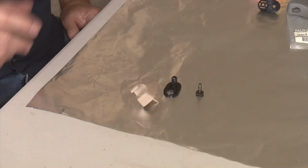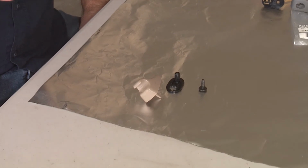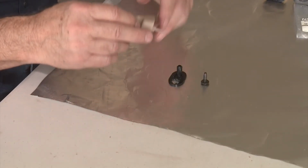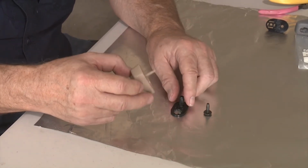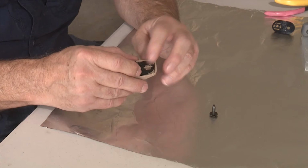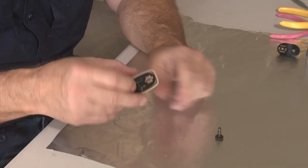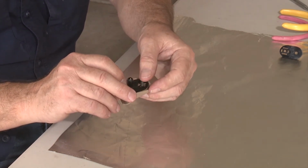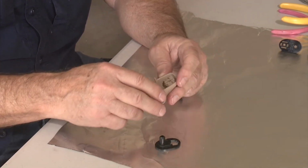So as we mentioned in the intro, a couple of things didn't quite go right as we were working on getting the moonroof motor put in place. One of the items was the passenger side sun visor. So this is the interior hook for the sun visor, not the pivot point. And when we pulled it out, the holder mechanism, which goes right there, broke. So this thing goes together like that, and then there's a snap piece that goes into the metal to hold this in place. And then you use a screw to expand those wings so that they will stay in place. So that broke. So there's no real good way to make that work.